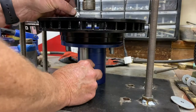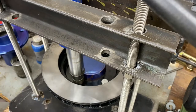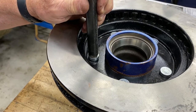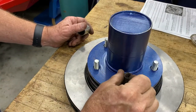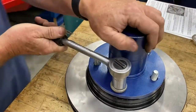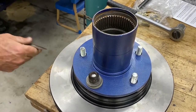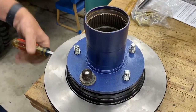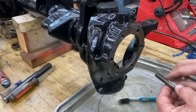Drop your lug screw in and press it in. Here's another method: drop your stud in, tap it in a little bit, put some washers on it, use a lug nut. That wasn't hard — you don't need hydraulics. Also, the vents on these rotors are straight, so you can stick one of these large screwdrivers in there as a handle. Nice and tight.